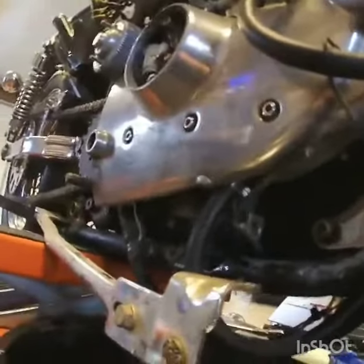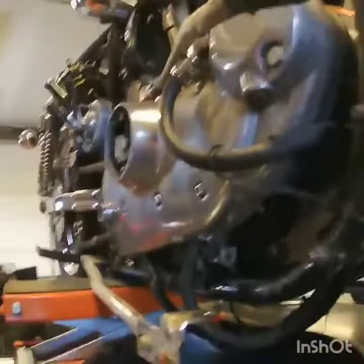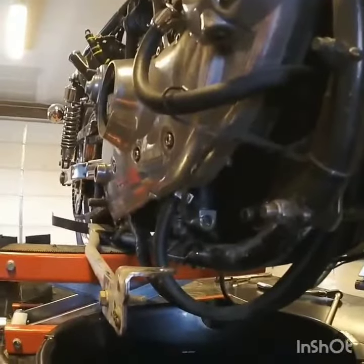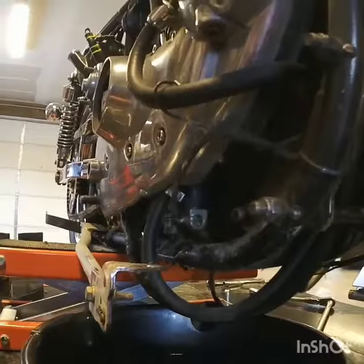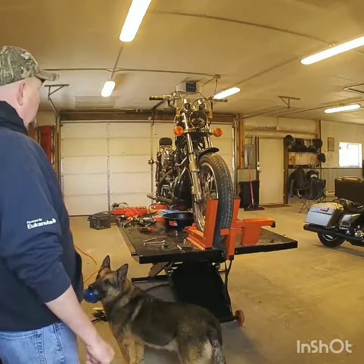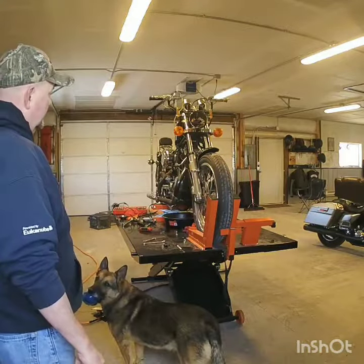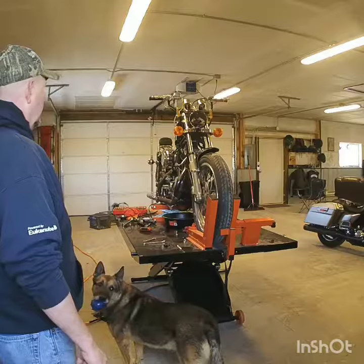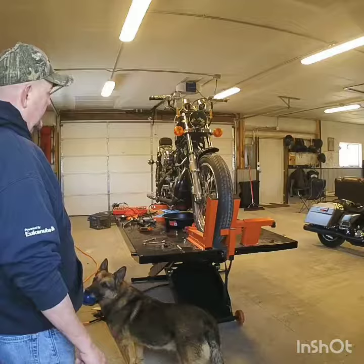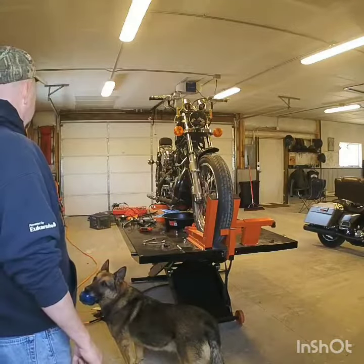From here, Brian, what do you think? We'll get to that, but we're gonna slap a few things back on it so we can see if the starter will fire it and go from there. All right, check the compression — we got 65 on the front cylinder and 60 on the rear cylinder. The rear cylinder is falling off, but it won't stop us. We're gonna try and find the starter relay — Colin hit the starter button.